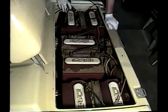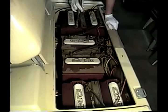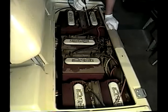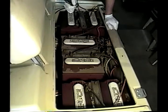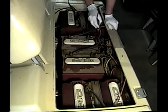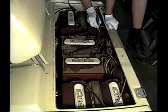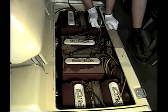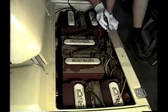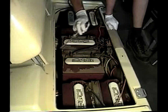Now checking the low-amp switching circuit: the way it works is we steal power from the batteries on the positive side of the circuit off of the controller. That current goes through the key switch first, then through the micro switch on the multi-step potentiometer down here. That micro switch is activated when you depress the accelerator, and it then comes up and goes through this first micro switch here. From that micro switch, it travels back to the solenoid to activate the system.